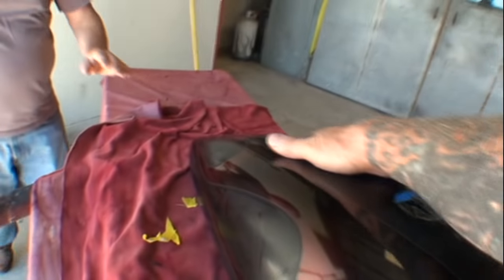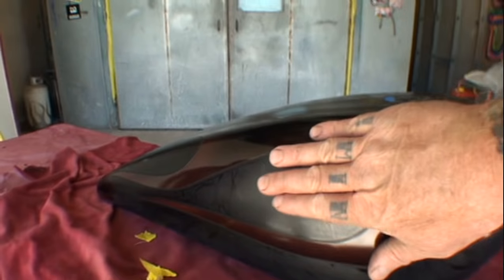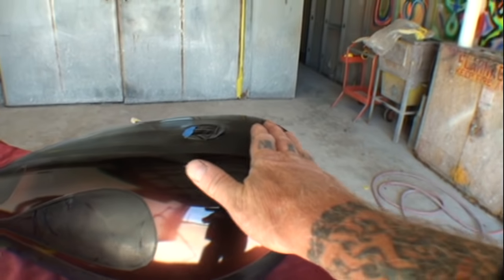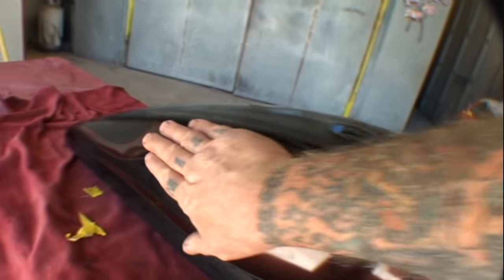If John can feel that — can you feel the tape line on that? Yeah. Okay. What we're going to do is take a piece of 1500, go ahead and sand the flames down and also get rid of all of our residue and our imperfections. That's why you have to use the intercoat clear that I mentioned earlier in this video set, because if you don't use it, you will ruin your paint job. It's very important to use the DBC 500 as you're going on painting your flame jobs.